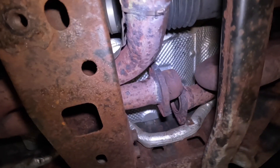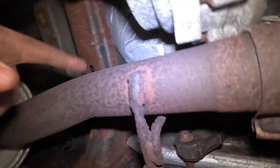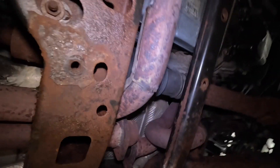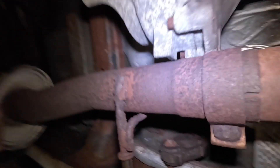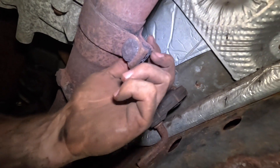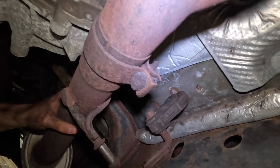After some investigating, between this whole weird section up here being blocked with this big muffler and a weird curved piece down there, we're definitely not going to be able to get this out in one piece. Two options: one, I can cut it right there, pull this way through that way, and slide this forward — because the muffler is not fitting through here if I pull it forward, and this piece isn't fitting through here if I pull backward. So either I remove this and take it off, or I cut it. I can either try to take this off by blasting it with PB Blaster, or just cut it.